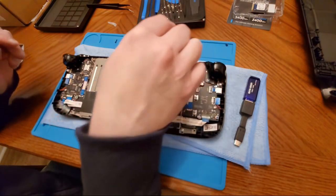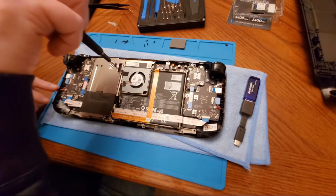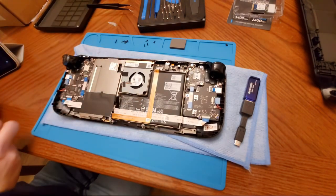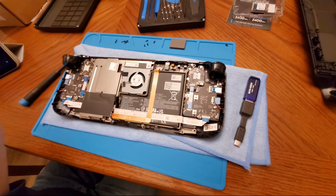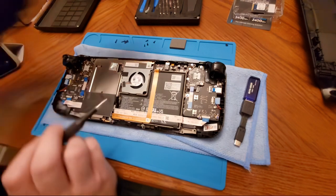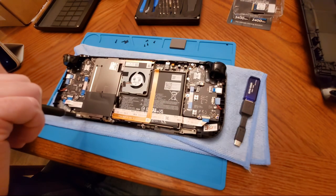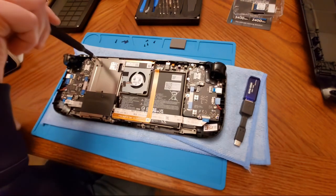The big separate screw goes in the middle first, then we cover the foil back over. I don't think there's anything you can do to make the foil look pretty again once you bend it — it's like tin foil, once it's bent it's bent. I highly recommend using a magnetic screwdriver — it makes things easier. Don't overtighten these tiny screws; just go until you get some resistance. The plate is back on, the battery is plugged in, and the M.2 is installed.